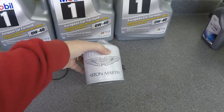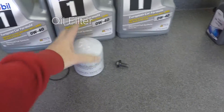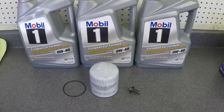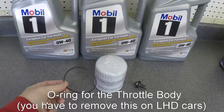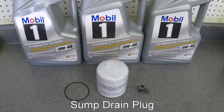You're going to need your ridiculously expensive Aston Martin oil filter. If you're in a left-hand drive car, which is the North American market, you're going to have to take off your throttle body on that side, so you're going to need the O-ring to replace during that maneuver.